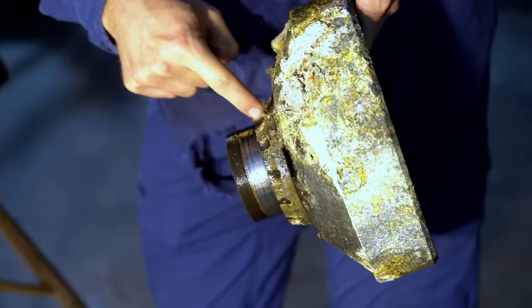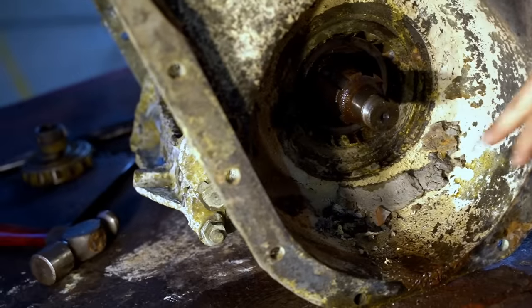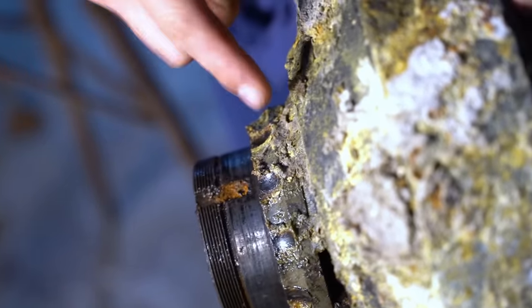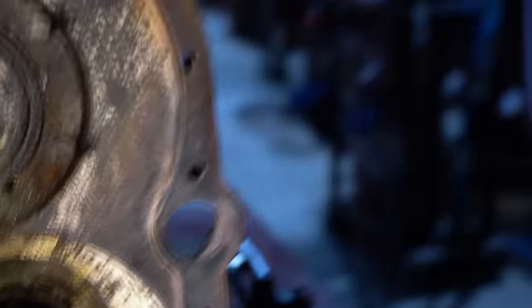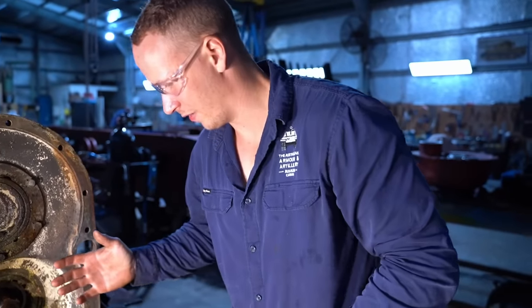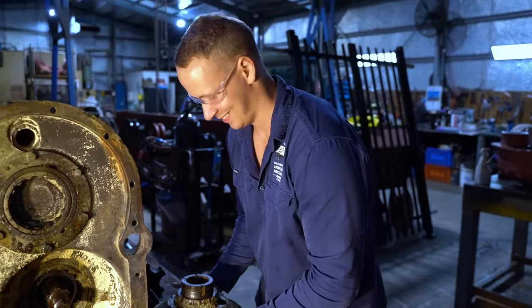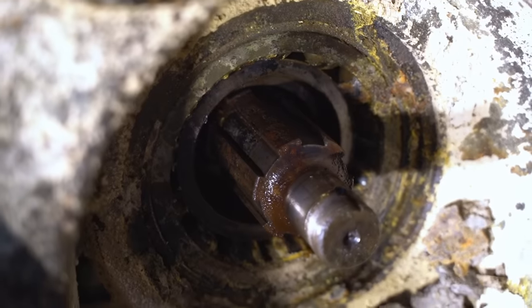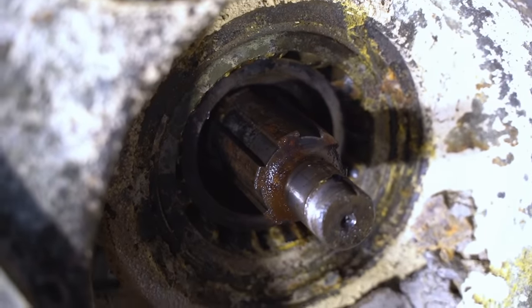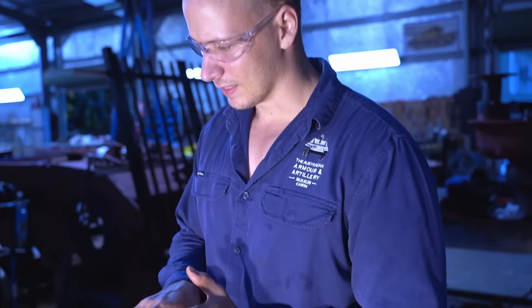There's another spacer here. Hang on — that's a part of the bearing inner. See that? The ball bearings have been sitting. It's actually curved. So that's a part of the bearing inner — there's two halves to it. You've got a bearing inner that goes halfway and then this one here meets up to it to complete it. Hopefully we can buy them like that. Same type of bearing, so you probably would. Like splines usually, because they're tight — a spline should be a perfect fit, or pretty close to perfect. And that pretty much seals itself from getting anything in.